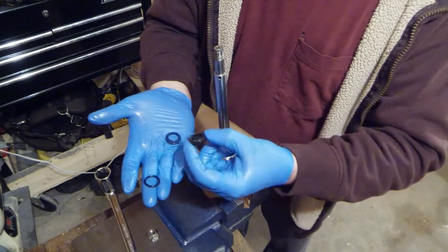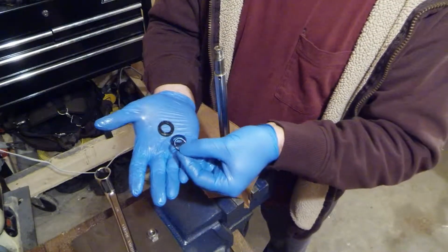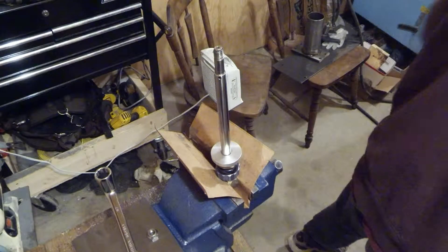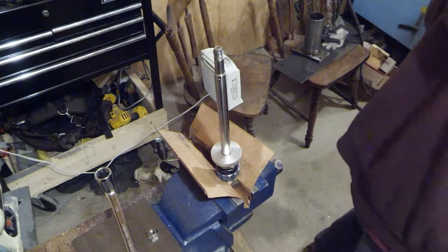Here are the examples: this is the inner one — it's a little bigger and heavier duty. This is the outer wiper. And here's the main shaft seal. When you put those in, make sure you lube the new ones or you'll cut them right away. And that is a big time disappointment.